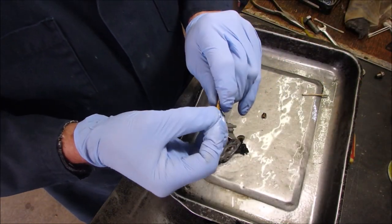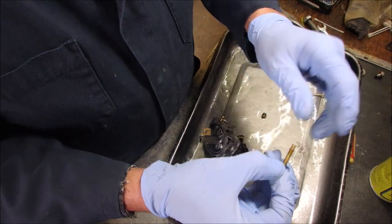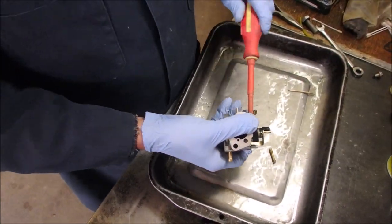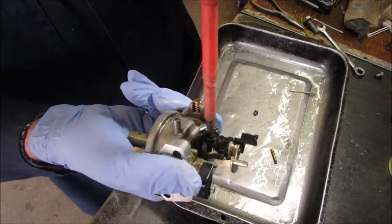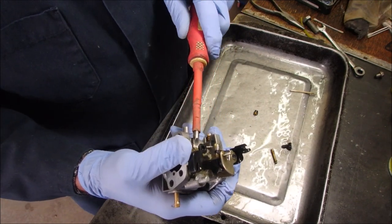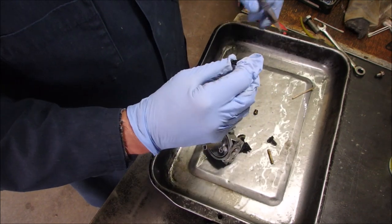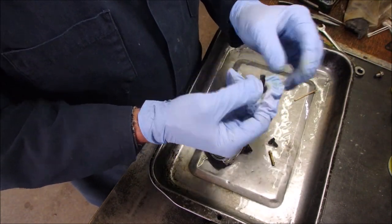I got it here from this side — block this bottom hole, this big hole, and we should see like six or seven stars squirting out of there. I don't like taking these out but I'm going to. This is just an idle set and idle orifice. I didn't wreck anything there — should be okay. Now squirting on the end of this — that doesn't look normal.